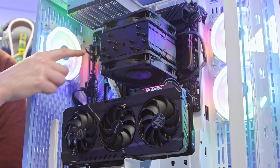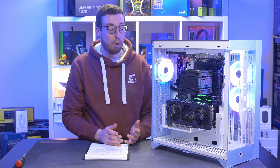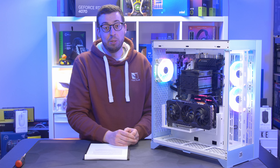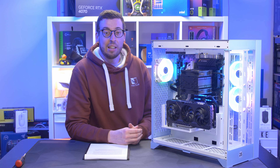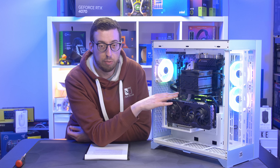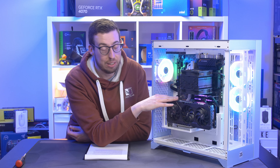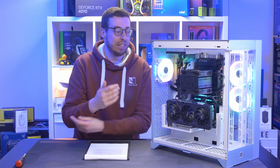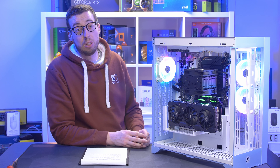Quickly touching on the riser cable and floating GPU bracket — Thermaltake clearly points you toward using this since they include the riser in the box, and they make it themselves so it won't add much of a premium. I wasn't initially a fan of it but after installation I genuinely like how it looks. If you're not going to use the floating bracket, be aware there are a couple of large holes for 24-pin and USB headers that are quite visible through the case, so take your time with cable management. A couple of grommets there would have been a nice touch to tidy things up, especially since gravity means loose cables will just fall down and be visible.